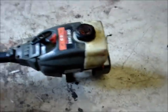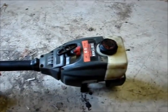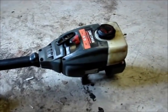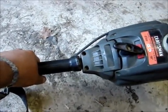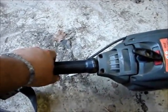I got the primer bulb installed and I've had it running. I had to adjust the carburetor, and I've got to find the air cleaner — I don't know what happened to it, I think it was on the bench and probably got put away with the other small engine parts. I had to adjust the carburetor a little bit because she didn't want to run good, and it doesn't rev up well. I think I might have changed this carburetor and it might actually be too small for this. But it does have a very heavy head, and once it's revved up it runs beautiful. It starts good and winds up good, doesn't seem to lug down, so I'm going to leave it alone.